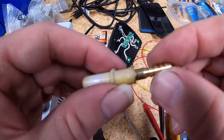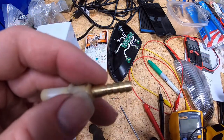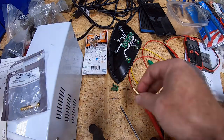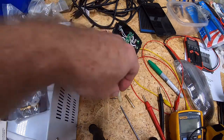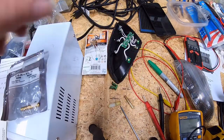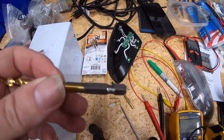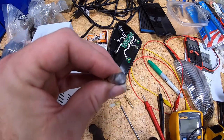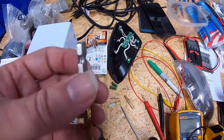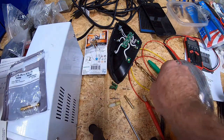We can mix up our epoxy, get that in there, and epoxy our barb in place. The key point is that we're going to have to do that same drilling technique on the vent on the tank, and we'll have to be really careful when we do that. I'm not going to bring an electric drill down there for obvious spark reasons near the fuel tank. These Milwaukee titanium bits have a nice hex shank on them — you can put that into a standard socket and just use a ratchet to use them as manual bits.